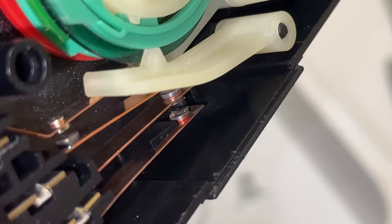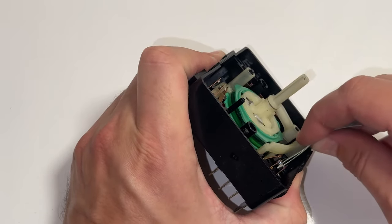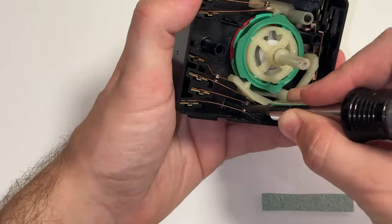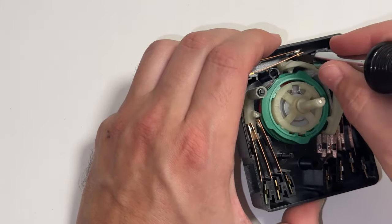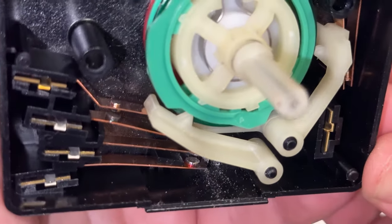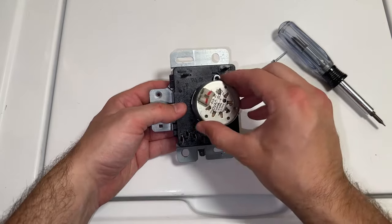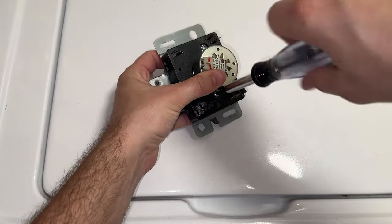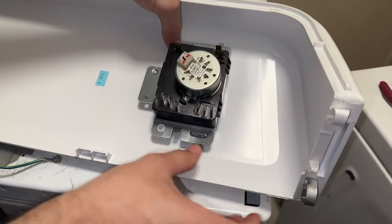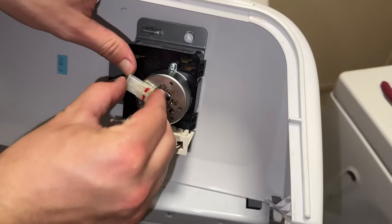When I started inspecting the contacts closely I noticed there was some kind of corrosion or crud built up on them, particularly one of them. Most of the others had fairly minor discoloration if anything. I took a small piece of sandpaper and started cleaning between the contacts, but I think I had better results using a flathead screwdriver. I went around and gave all the contacts a light scraping, but I suspect it was that one gunked-up contact that was the problem. I put the metal plate back onto the body of the timer, placed the cylinder with the two sprockets on the back, slightly turned the knob to get it to seat, and put both screws back in. I pressed the timer back into place on the front panel, reconnected the ground and the other three cables, and put the knob back on the front.